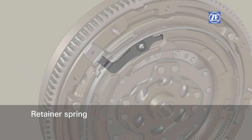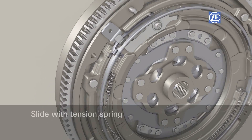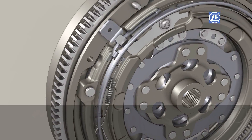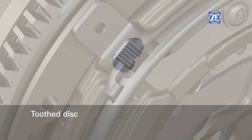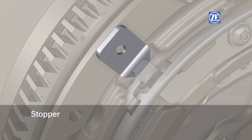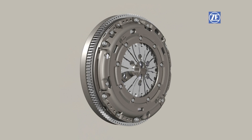The retainer spring in the form of a leaf spring. The wedge-shaped and toothed slide with an additional tension spring. The toothed disc located in the clutch cover. And the stopper wedge between the flywheel and the housing, which forms the mechanical link between the wearing path and the compensation system. In all other features, Xtend is like a conventional clutch cover.